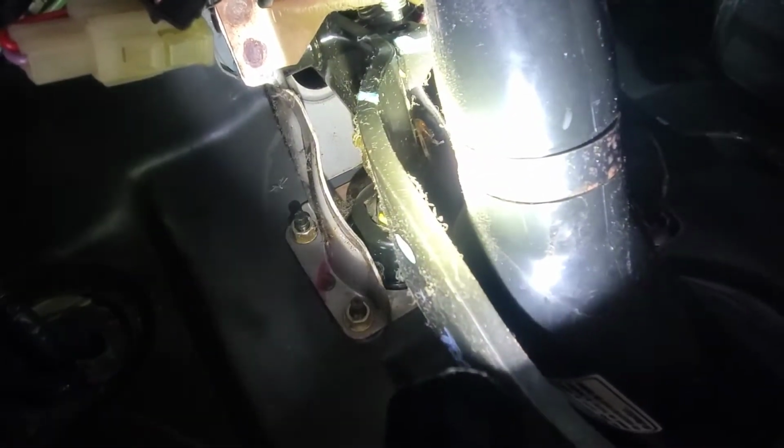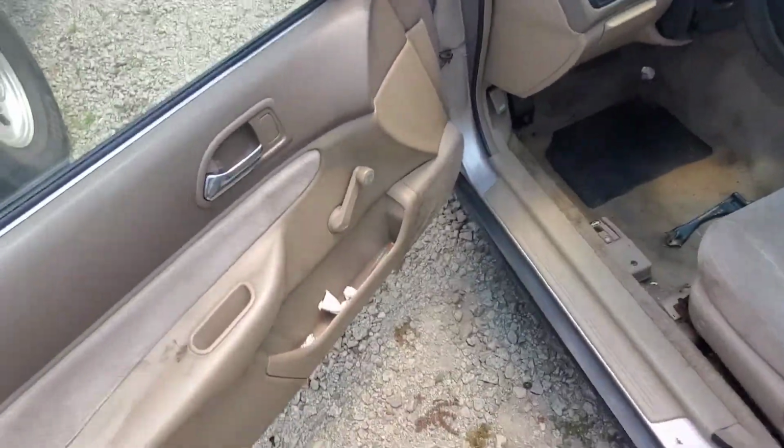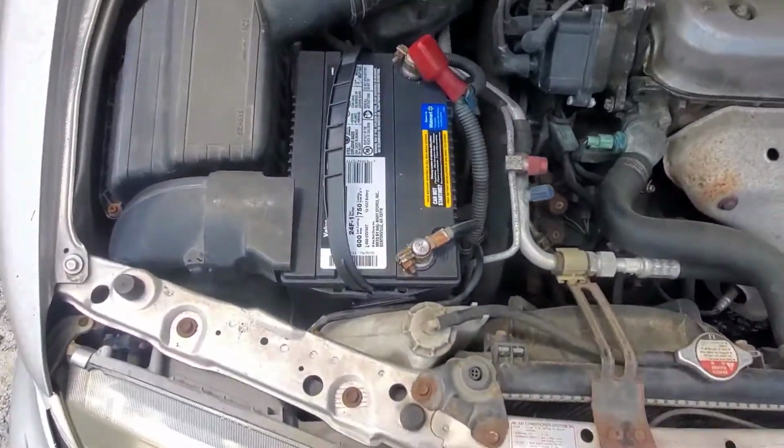You can see that hole right there where the blue paint is. There should be that plunger in there. So that was their original problem. That piece is gone. And that's what drained their battery by leaving the brake lights on, causing further problems for the DIYer.